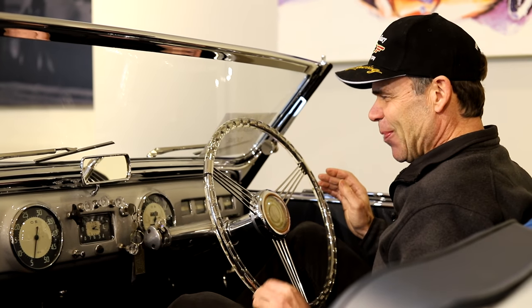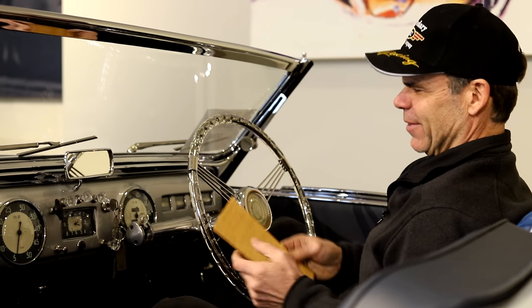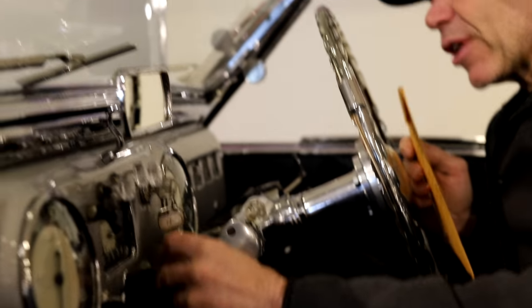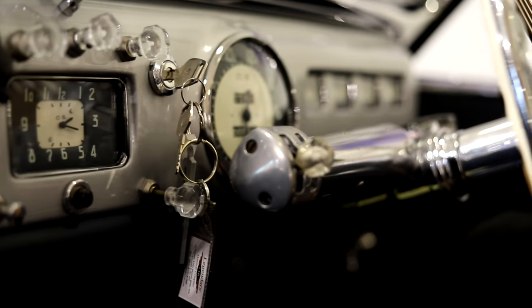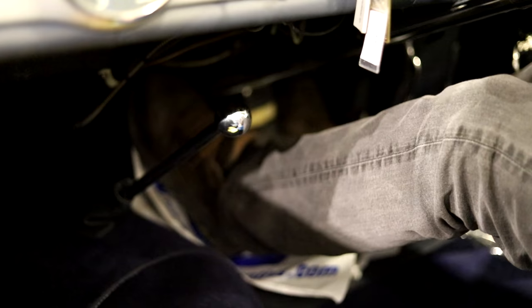The interior is really cool on this car too. With a lot of these old cars, when you get in them, they have quirky things on how to start them — you've got to figure out what all the buttons are for. So we have a cheat sheet. There's a battery switch under the dash, then the ignition key has to be on, and the electric pump is this knob here. Now here's the tricky part: it's got a pre-select transmission — first, second, third, and fourth, which is pretty straightforward. There's no reverse. So it took me a while to figure out where reverse is, and unfortunately it's not on the cheat sheet. There's another shifter way down here — this is reverse, but this little knob has to be in third gear for reverse. This has to be down here, and then we've got reverse.